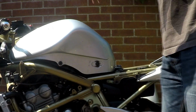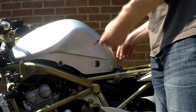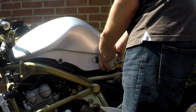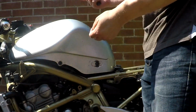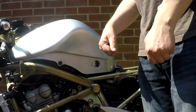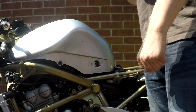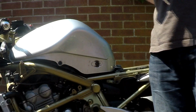And there's a little bit what the seat goes into. That should just lift up like that. And you've got to find these like breather pipe. And the other side there's the little red clip where you put a straight edge screwdriver in, twist it to pull down the bit, and then it pulls off. Then you can lift that off. It's pretty simple really. But I need to go and get something to put it down on.